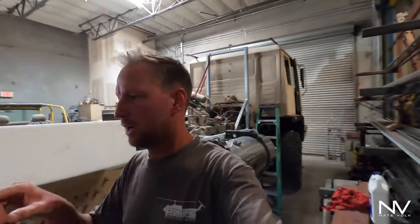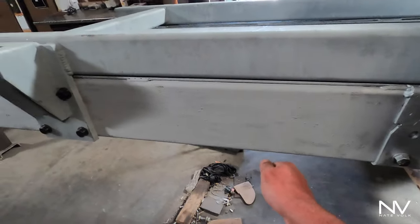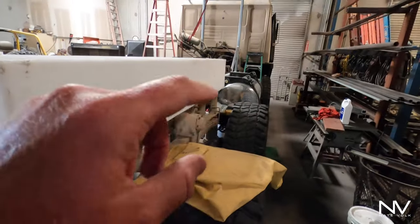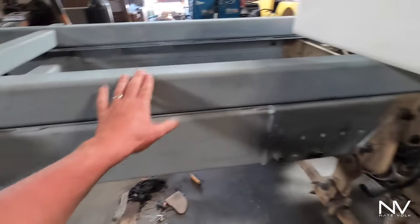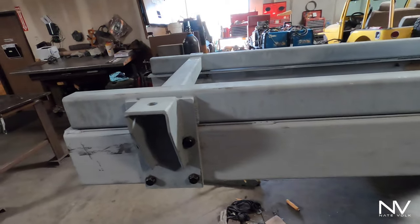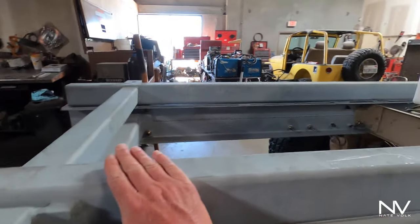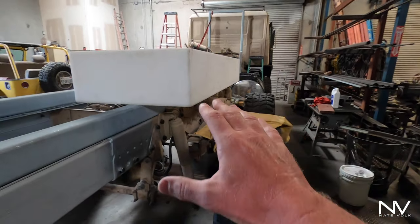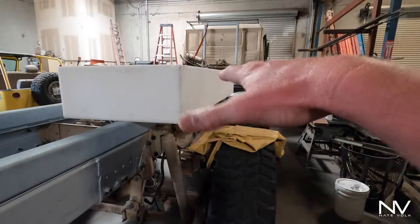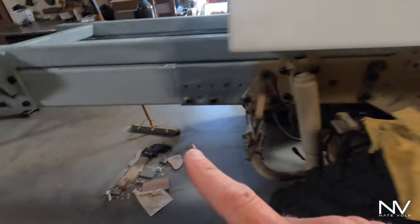I'm thinking of putting the handles in the back — I'm not sure yet. One handle up and down will do the lift on the back for the motorcycles and spare tires. One handle will tilt the cab up and down. Then I'll have four handles for leveling the subframe. I'm also going to have rams here that go up and push against the next level of subframe, so if the truck is not perfectly level I can move these corners independently. It's a captured spring so there's no stress on the box whatsoever — no resistance or twisting.